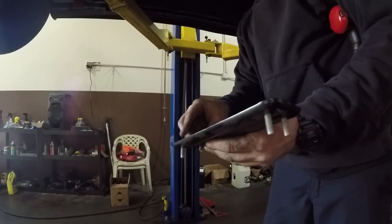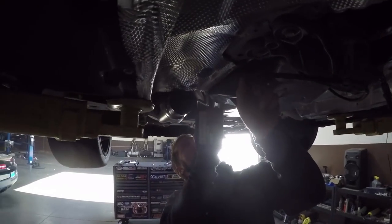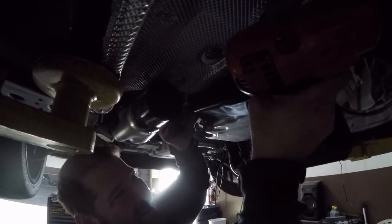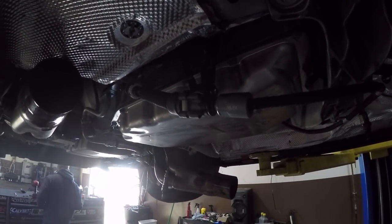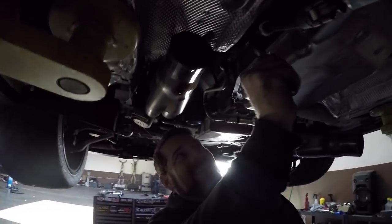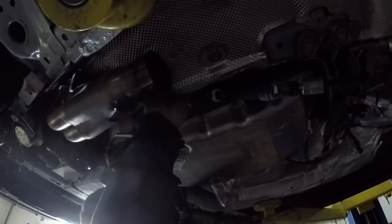There's a little tunnel brace that doubles as a driveshaft loop. There's also some miscellaneous shielding — all this stuff has to come off. Removing a bolt reveals your shifter cable; it's literally just sitting in a bracket. Drop that down. To avoid breaking the plastic clips, just pull the nut.